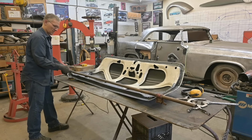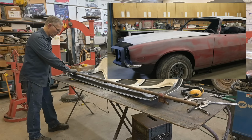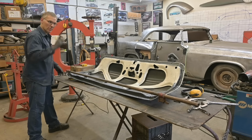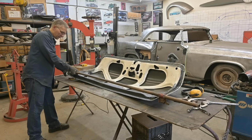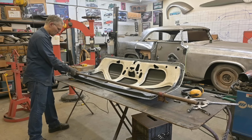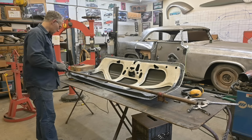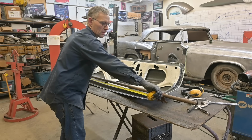We had a 70 Camaro, I think it was a 70 Camaro, all in primer came in. It was through 3 different shops and everybody tried to set the gaps on it. The car, when it came here, was an absolute disaster. Check out the video, I'll put a card up above. The client didn't want to pull the quarters off. He's on a limited budget. And we respected that budget by leaving the quarters on and adjusting every single panel on the car by pushing and pulling. It was some pretty serious business that we did, but we got it. And the customer was quite pleased with it.